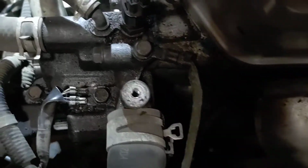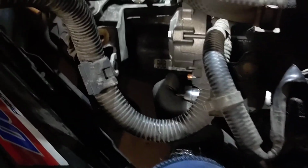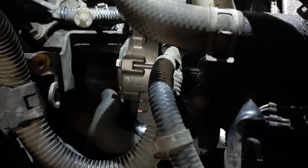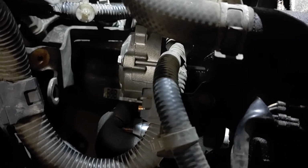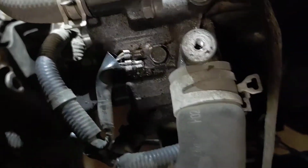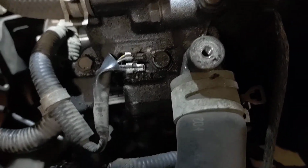And then if you come to the front of the engine, the front of the starter, there is your second 14 millimeter right down below the starter housing. So the top one is farther away from the starter housing. This one's only like an inch over and against the engine block. So my hand is like directly under this. And there's your starter bolt. Both 14 millimeters. They're about this long.